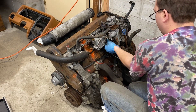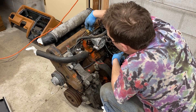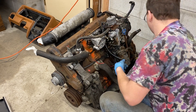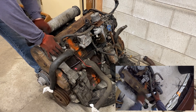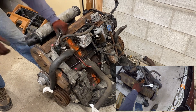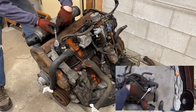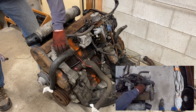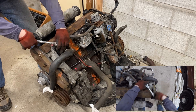It's a very tiny space, so you'll just have to do your best. Now it's time to pull out the injectors themselves. This requires a 27 millimeter extra-deep socket — a normal 27 socket won't work, I tried that initially. I'll include a link to the one I got off Amazon. Fair warning: getting it off with just an end wrench is not reasonable. I had a breaker bar and then a five-foot cheater bar on it. If you've got to put some serious force on it, don't worry — they can take it.